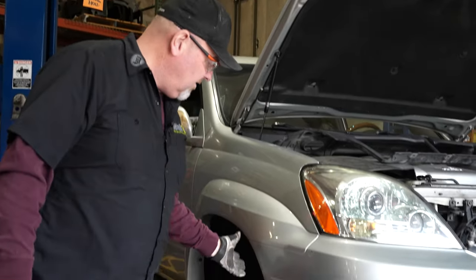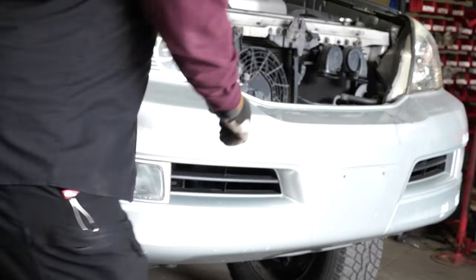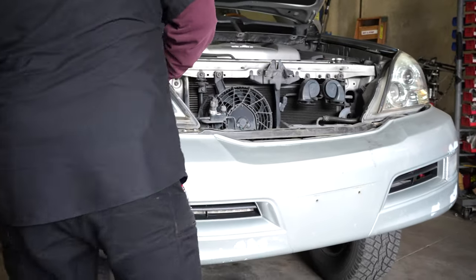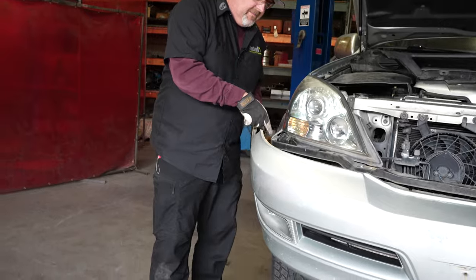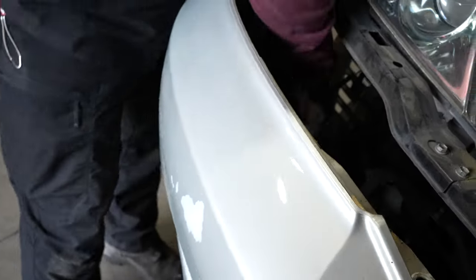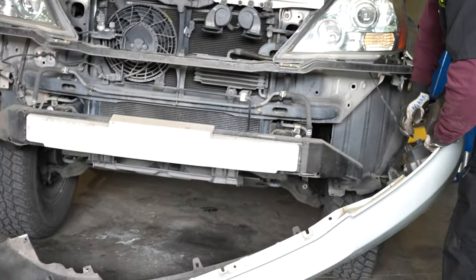To pull the bumper off the truck, you grab it from the side. Once the fasteners are removed, you just start popping it out and it'll start coming off the truck. Be aware there's plastic down below that's in place and will need to get released. As I pull this away, I can see the electrical connection for the factory fog lights. I'll come in and undo that clip, do the other side, and then the whole front piece comes right off. I'll grab it in the wheel well and yank outward.